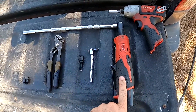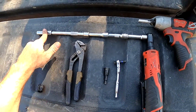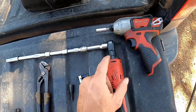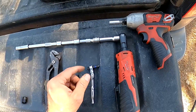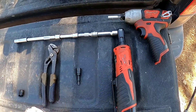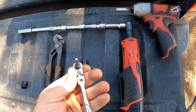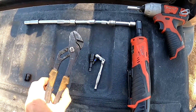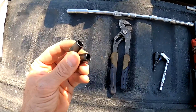I use this ratcheting wrench because it's a whole lot easier with a bunch of extensions — with an 11 millimeter on it. I'm gonna use this to get the clamps off, with a 5/16 nut driver. You can use a flathead screwdriver as well. To get to the blue spring you've got to use a T25, and I just have one on a ratcheting wrench.